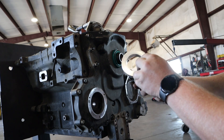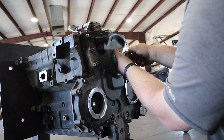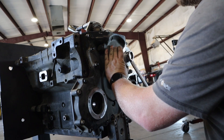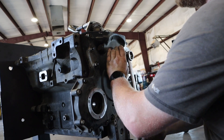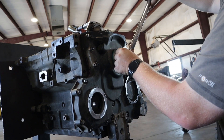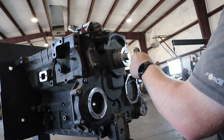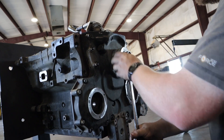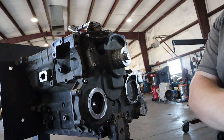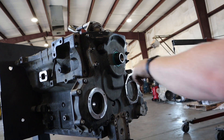Now I've got my second ring. I'm going to place that there — jiggle it a little bit, make sure it's centered. So you can buy these John Deere tools, but instead of buying it for $100, I'd rather spend three days making something — it's not that bad. And then just go until it doesn't turn anymore. There we are. Installed front main seal.